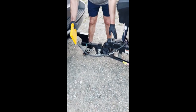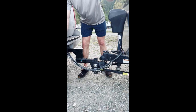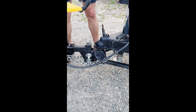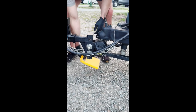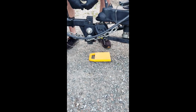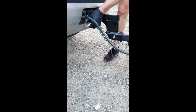Now we're going to take the trailer off the hitch. The first step is to take the safety pin out and pull up, and that's going to allow the trailer to release eventually. If you're on really unstable ground, you're going to want to put a block underneath so that the foot has something stable to rest on — maybe grass or dirt or something like that. In this situation, we have a little bit of loose gravel, but it's really hard, so I'm not going to use one. We can take off the safety chains.